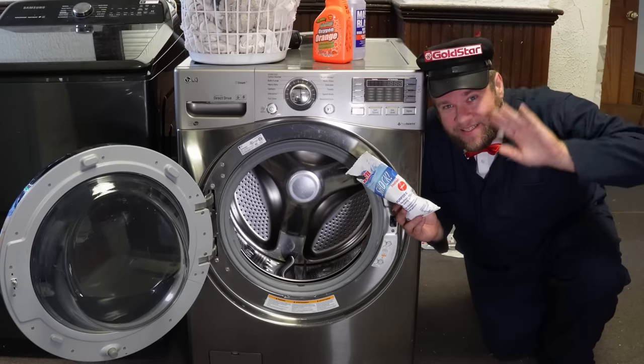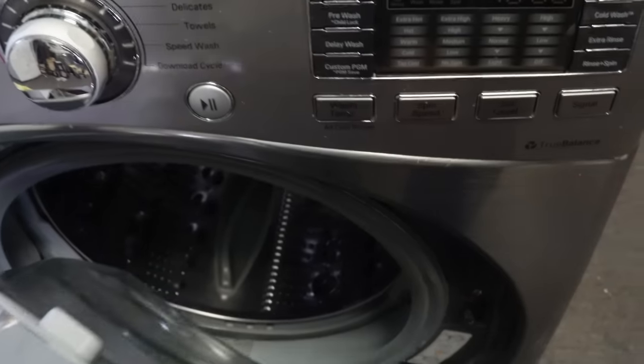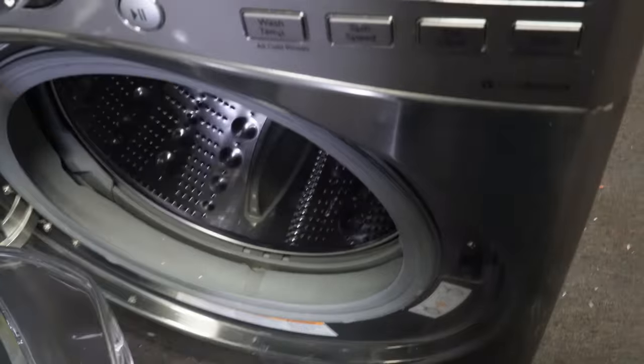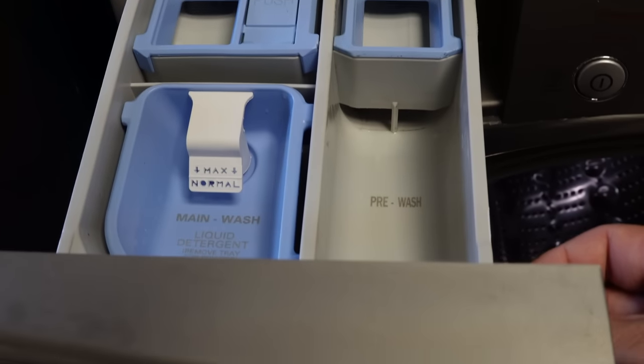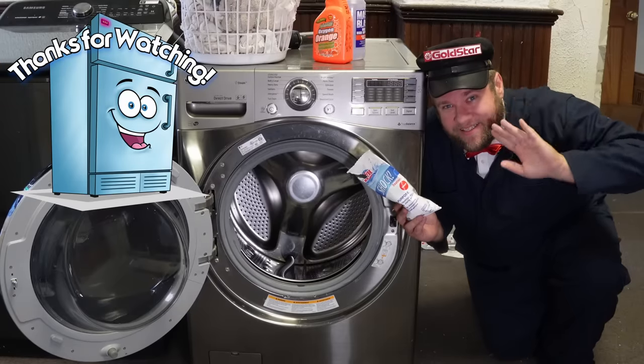Hopefully this gave you a good idea on how to take care of dangerous mold on your door boot seal. Remember that if you don't keep the washing machine door slightly open after each use and wipe down the bottom of the seal where the coin trap is, the mold could come back. I'll also be uploading another video in the near future on how to clean all the other parts of a washing machine through regular maintenance, since that's been often requested. I did it for a top load and we'll do it for a front load soon too. Make sure to subscribe for that and I hope you have a great day.